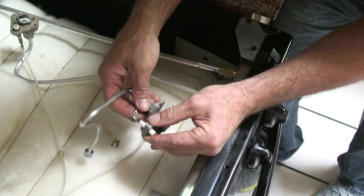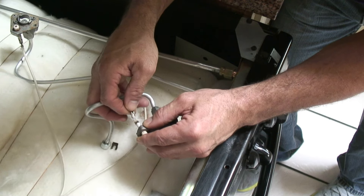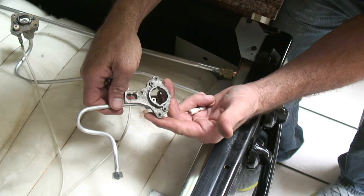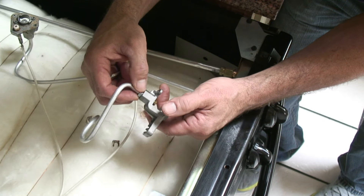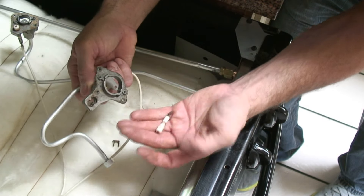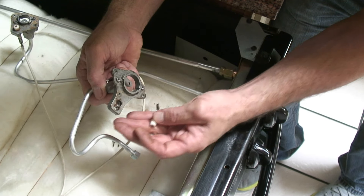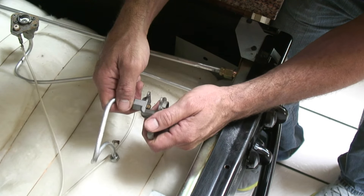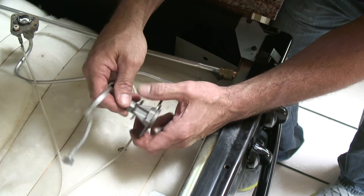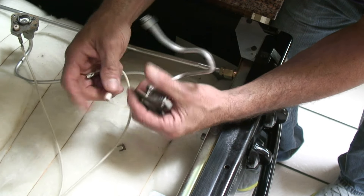I'm going to put my igniter back in — I just wanted to show you how it was done. You can take this whole piece down to your local dealer and get a new piece. Just take this off your tubing here if it's in good shape. If the igniter is the only problem, you can replace just this. There are a number of places online where you can order these parts. All you have to do is take your model number and the make of your stove, google it, and you'll find all kinds of parts places for it.